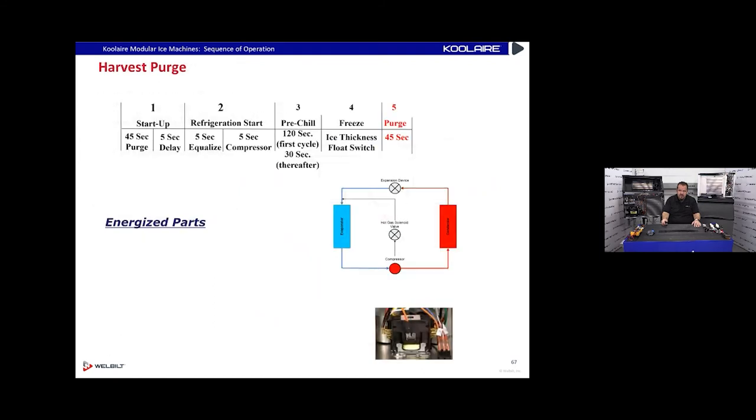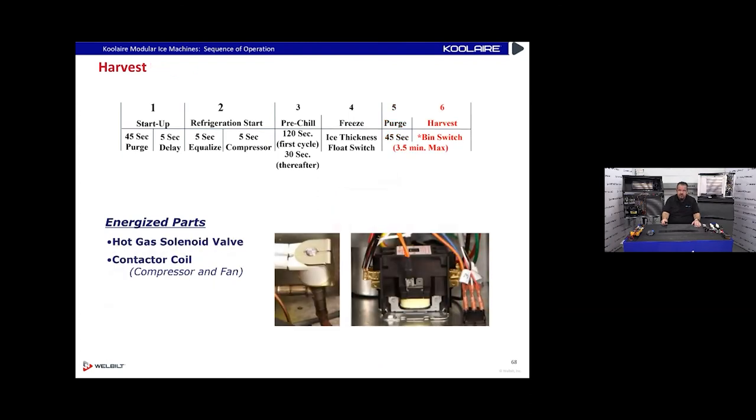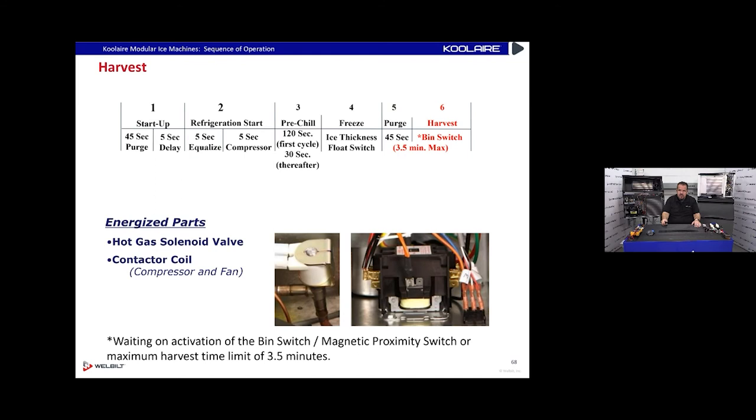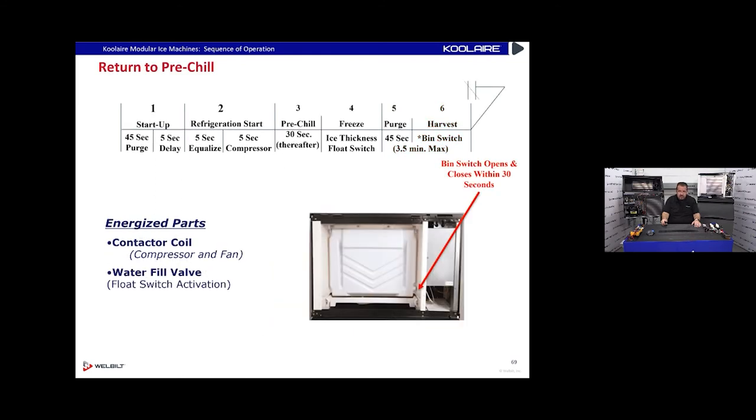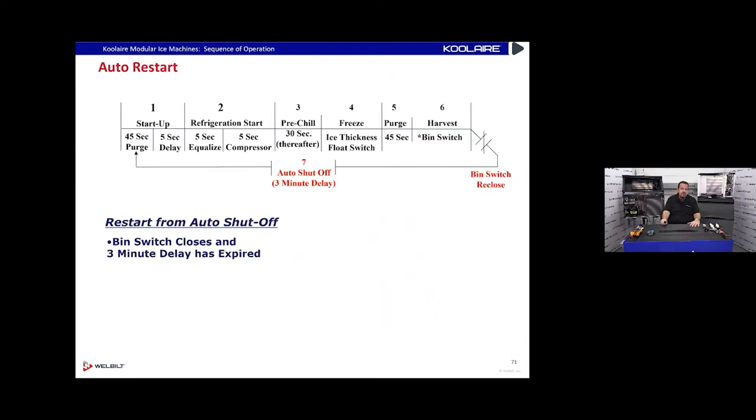Twelve seconds of water is shot in just in case there's any slush left — that'll melt it out. The water turns to ice on the evaporator and as it vanishes the harvest float drops out, starting the harvest cycle. To force a harvest cycle, wait six minutes into a freeze cycle, push the harvest valve down and hold it for about five seconds. Hot gas goes into the evaporator, drops ice off the grid, the curtain switches as ice drops, then we go back to pre-chill. When ice fills the bin, the curtain gets stuck open for 30 seconds and we go off on a full bin — not allowed to come back on for at least three minutes.